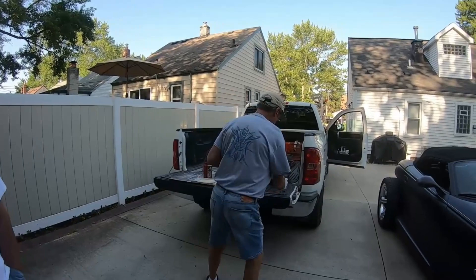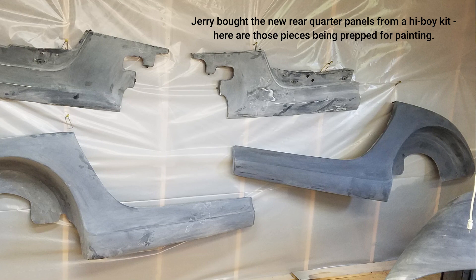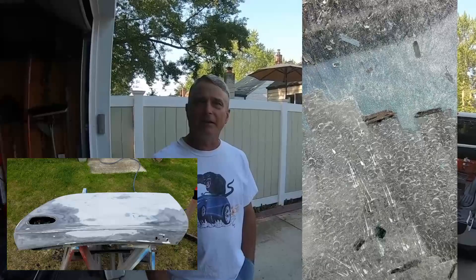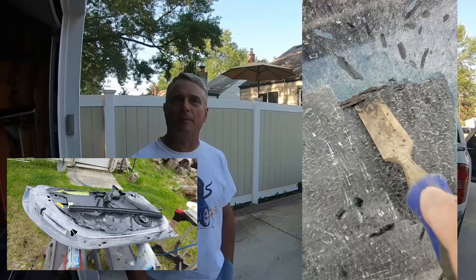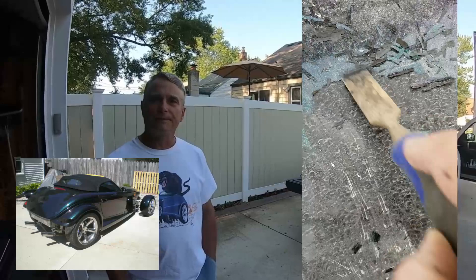So who actually did the most work - obviously the rear quarter panels and rear belly panels? I did it myself. I sent the car out to a buddy of mine to paint once I modified the whole body. He had to strip the whole paint off - he used like a putty knife just to take the paint off because it was poorly applied. It was a flip-flop type paint job. At first I thought it was just purple, but the more I looked at it I realized it was actually flip-flop paint, and that painter didn't know what he was doing. The paint never set up properly and it was just flaking - you could take your fingernail and scrape it off. So I knew I was going to have to strip the car down to bare body and get it redone.